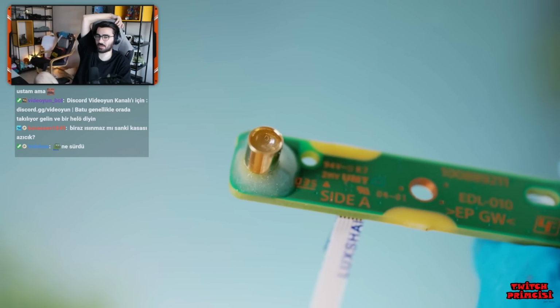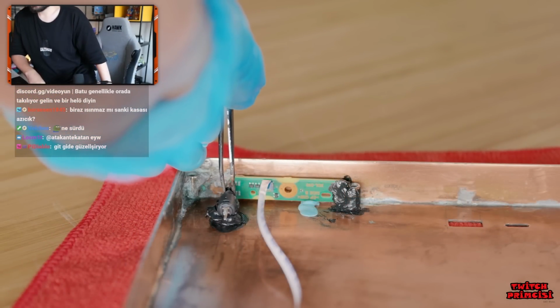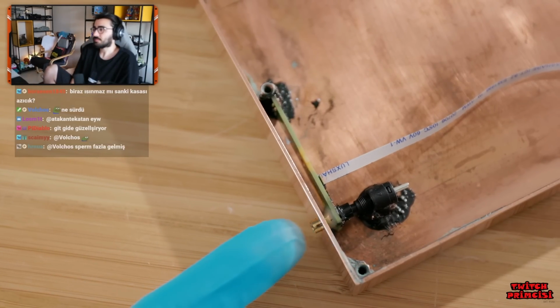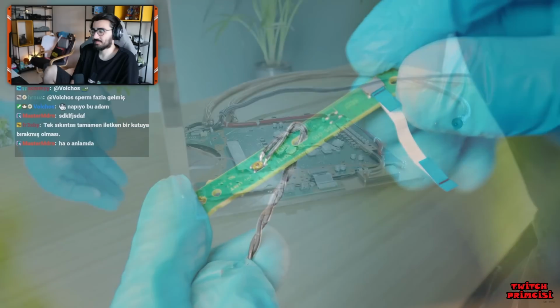As the PC LED board itself doesn't actually feature a button of any kind, some glue can be used at the other end to anchor it, so that when pressed it can trigger a little push button mounted behind it. This push button in turn is wired up to the original power button and will thus trigger the PS5 to turn on or off when pressed.